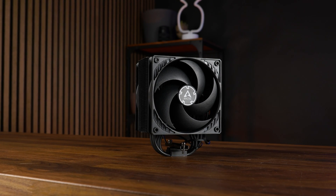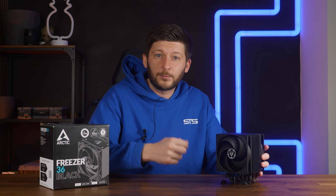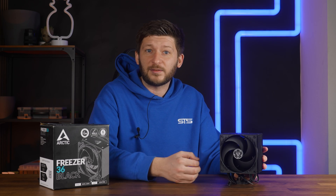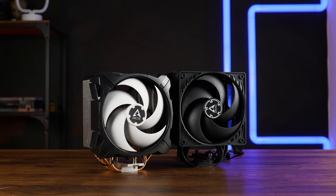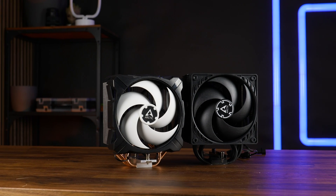The reason I find this method so cool is because you can't see it on the outside — it's invisible. But most importantly, the holes and screws are located based on the 120mm standard, which is based on screw hole location, not the outside of the fan. So you can take whatever 120mm fan you want, move the screws over, and keep using the heatsink — swap for other Arctic fans, Noctua, whatever you want. If the fan dies, if you want to upgrade, or if you're sick of the color, you have the ability to do so. Whereas with the Freezer 35, you were pretty much stuck because half of that thing was one giant piece of plastic. Really cool, upgradable, and usability at its finest.